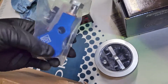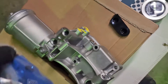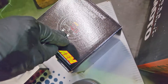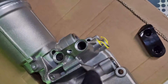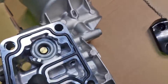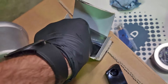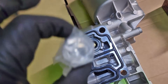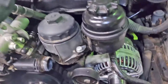While we're in there, we're going to be using this Rally Road oil distribution block that mounts on the housing back here. That's going to give us an opportunity to get oil temperature and run an oil temperature gauge into the cab. One thing we're going to do before we install this is delete the thermostat right here - VAC makes a delete kit for that, here's your part number.